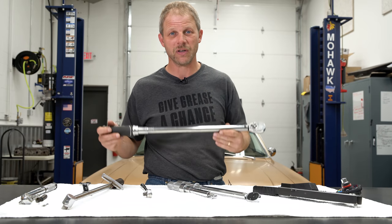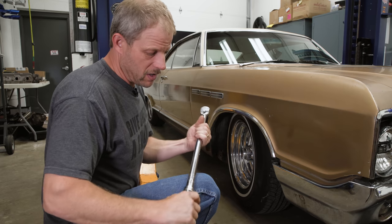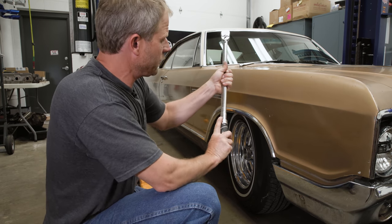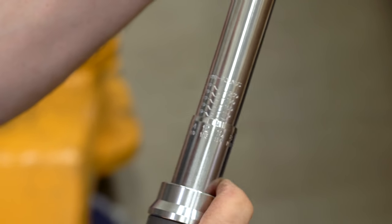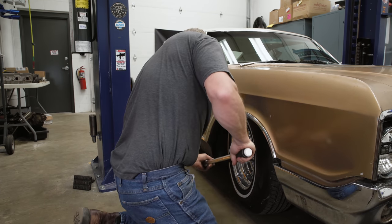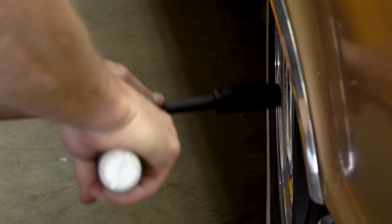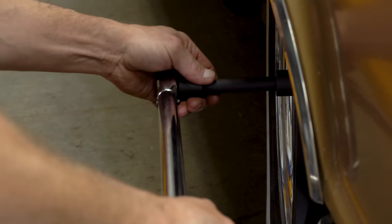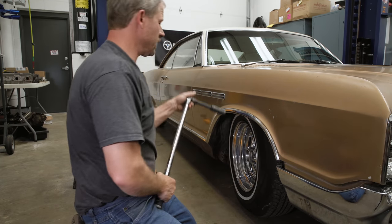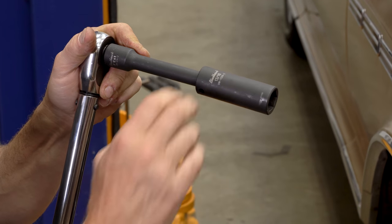Let's put this to work and show some application on a wheel. To put our torque knowledge to use, we're going to use this wheel as an example on this large foot-pound torque wrench. As you go through and set your torque by twisting the handle, set it to 85 foot-pounds, bring it in, and go in our crisscross pattern. You can certainly hear the click of the wrench and feel it in your hand. Also note: in this exact spot I needed to use an extension heavy enough to transmit that torque into the wheel without any loss.